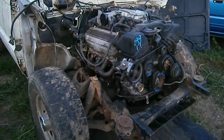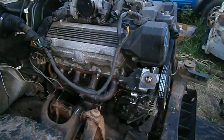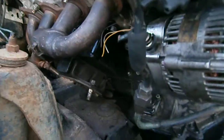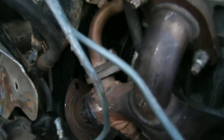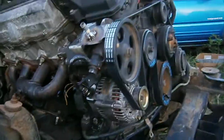I know this doesn't look a whole lot different than it has, but I pulled the motor back out and basically getting everything prepped to start this motor and install it. I painted the engine brackets. I've got the exhaust and the EGR hooked up. Modified the power steering inlet here. The alternator, all the accessories are mounted. I've got the belt on there. The pan mod is all done now. I've got the pan painted.